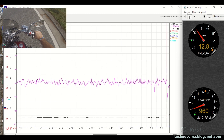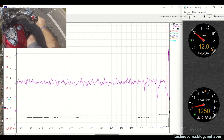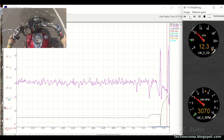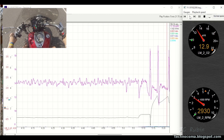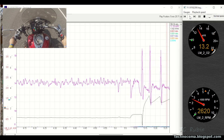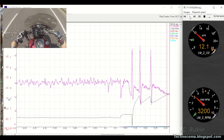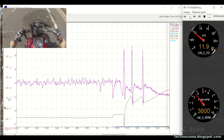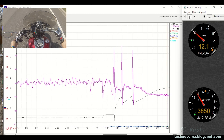Now a more non-aggressive acceleration from a U-turn, and once I load it up on the next gear you can see it dropping into the mid-12s. I'll stress I'm not laying on it at wide-open throttle to get this into the 12s - I'm just loading it up a little. Here we can see the mixture gets richer and it's linear to the engine acceleration. As the RPMs go up, the mixture goes down almost perfectly. Then it starts to taper off because it becomes downhill and there's less load on the engine.